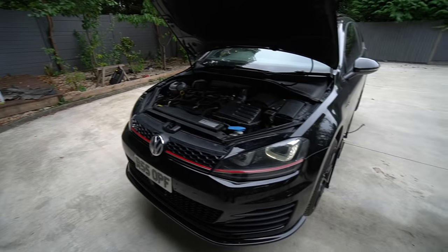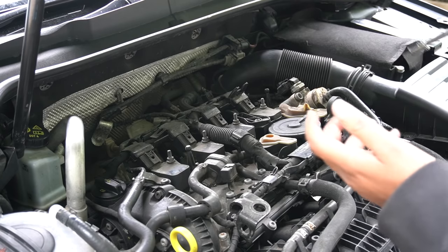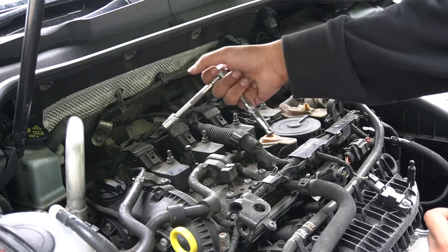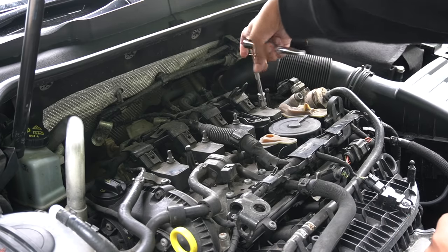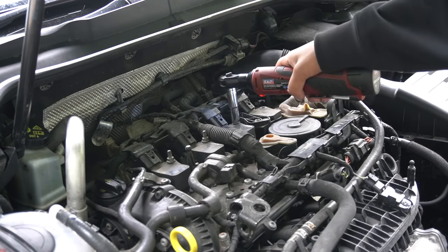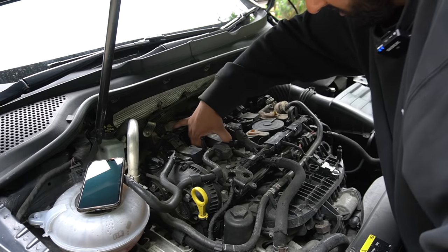What we'll begin with first though is the spark plugs and coil packs. Now some of the tutorials I've watched online of these being removed, they have ground wires on them on the top, but these don't seem to have any. There's just 4 10mm, so we'll start removing these. Got lazy. Let me get a pick in here. This wire on top is very snug.